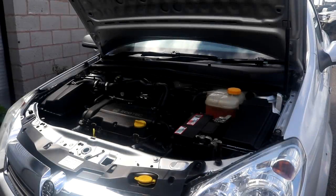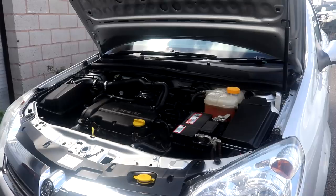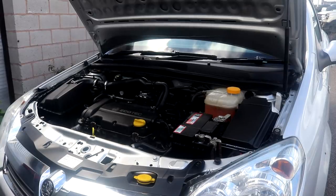After finishing the engine bay detail, start the vehicle up and allow it to run for 5 minutes just to burn off any products or water that we weren't able to remove, and of course to make sure that the engine still starts. Modern automotive engines are designed to withstand a certain amount of a beating from the rain, so more than likely the car will be fine.